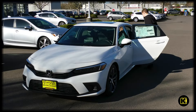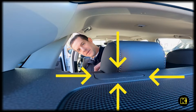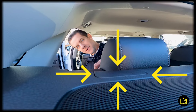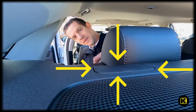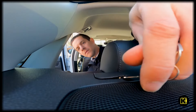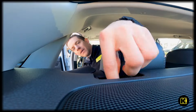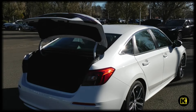Something a lot of people don't know is there's a hidden compartment in the back of the car. This hidden compartment is a little plastic square located behind the second row driver's side headrest. It can easily be pried open with something like the key that comes with your key fob. Once you open the compartment, there is a metal latch that you simply pull to open the trunk.